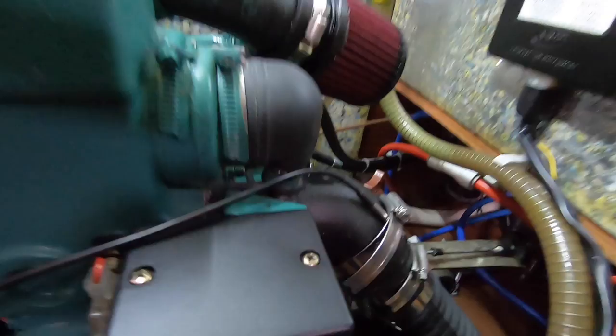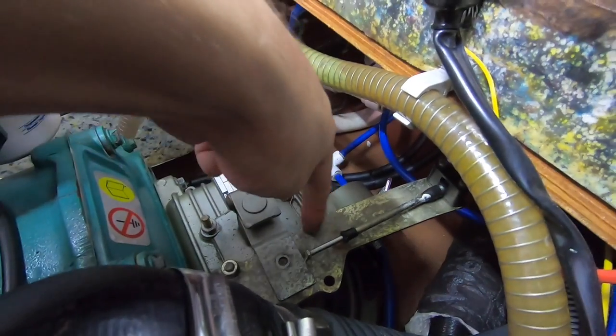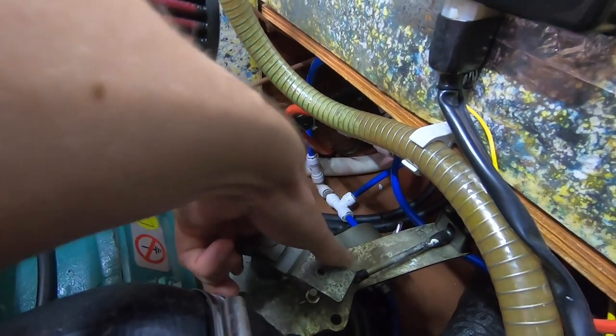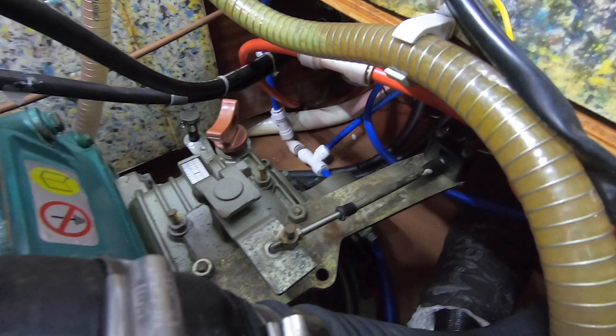It's a day of many jobs. If you remember a little while ago we had a problem with our gears — our gear linkage. This here is the gear linkage on the back of the sail drive, and that is in our neutral position. You can see where this was being pulled almost all the way back to nearly forward, which is why it's so hard now to push it forward. You can't adjust it at the two pins at the back — that simply holds the cable in place. What you need to do is adjust it at the top end where you can see the small nut and the brass pin, and you have to do that on both ends if you need a lot of adjustment.